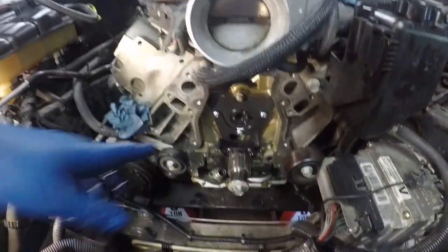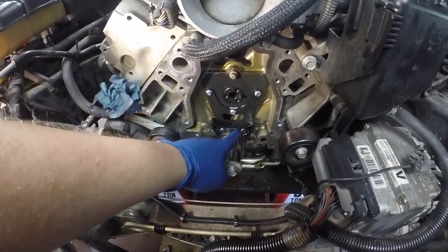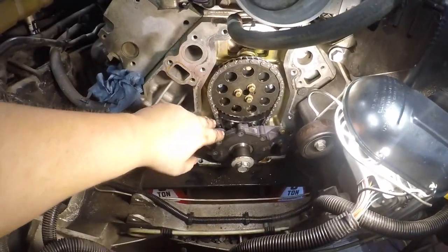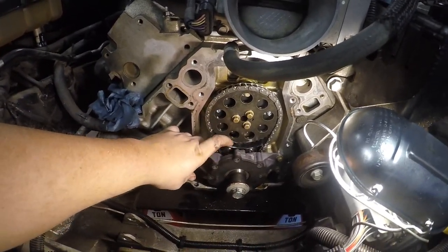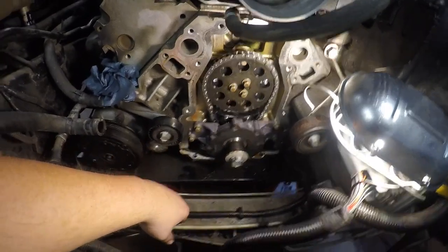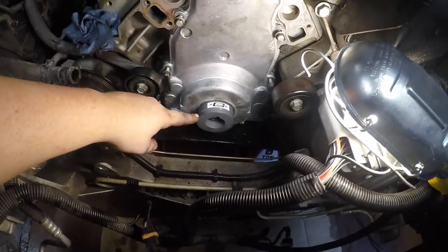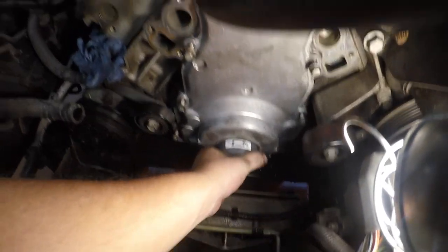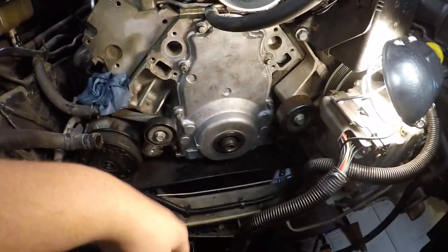We got the cam cleaned off with a fresh coat of oil on it. With the new Texas Speed cam now installed, I got the cam retaining plate back on and also the aftermarket Melling bracket for the later timing chain dampener. The new timing chain is on with the dampener, everything torqued down — made sure to get those timing dots lined up again. I also got the oil pump put on and torqued down. Next is the timing cover — got it cleaned up with the new gasket, all bolts started around the perimeter, slipped in the Mr. Gasket timing cover alignment tool so I can get it to spin freely, then snugged up the bolts and torqued everything down.